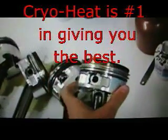After 1,000 pulls at anywhere from a thousand to fourteen hundred horsepower — totally insane. Check out the skirt wear: there's basically none. You don't see any combustion getting by the second ring. This is one seriously beefy combination that we've put together. The factory pistons hold up reasonably well, but nothing like this.